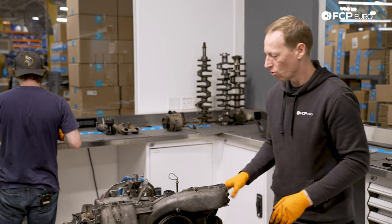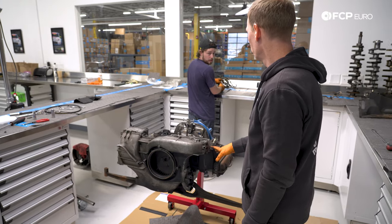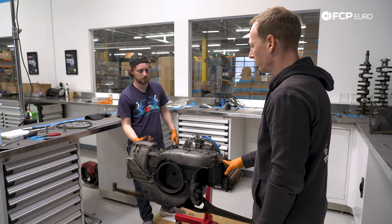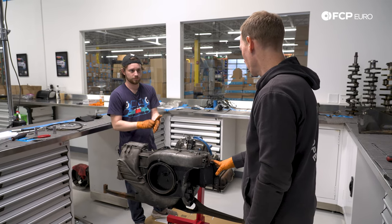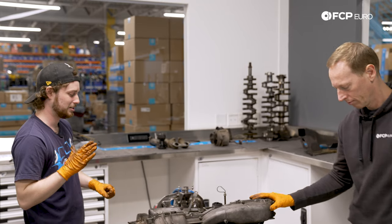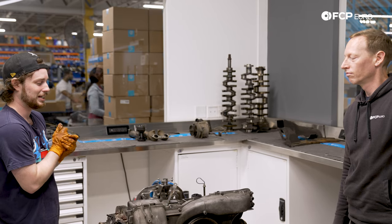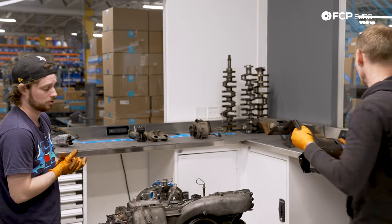So what's the oil capacity? This is a wet sump engine. About four quarts — and that's with the deep sump on the bottom, which is shaped like a tuna can for another half quart. That's not a ton of oil, but it's fine for daily driving or even some spirited driving and autocrosses. But if you want to go to the racetrack and you're using sticky tires like I plan on doing, you're gonna starve your engine of oil — so dry sump, we'll see.